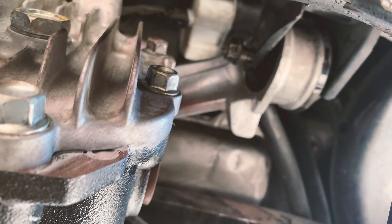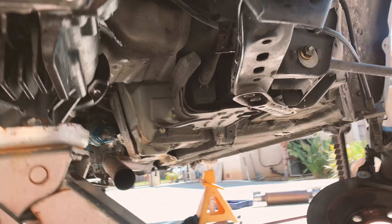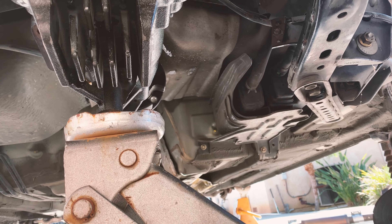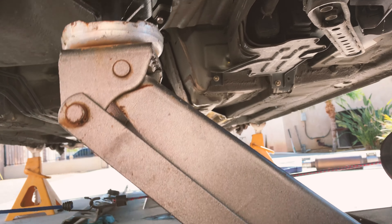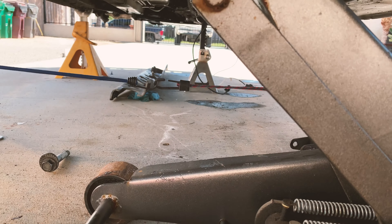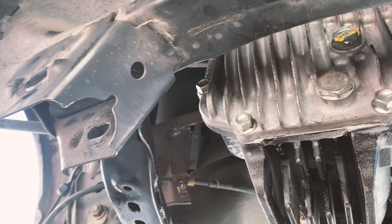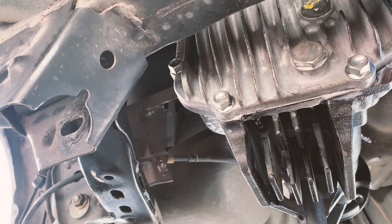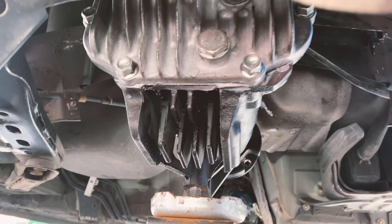New diff is in. I started the top bolt up there and I'm about to start the other one. I did this by myself and it was a little difficult — putting it on the jack it kept falling off each time. What I did was get under it, let it hang on the supports for a second until I got the jack underneath, then went very slowly up until it seated into the clevis up top. Now they're both in and I'm keeping pressure on the jack so I don't drop it. I'll tighten the bolts and get the power plant frame back on.